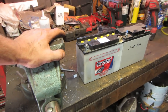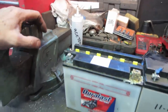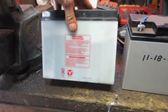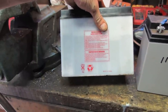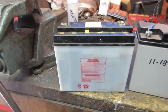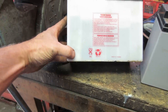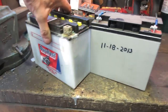Other things I need is a battery. That battery took somewhat of a charge but not a great charge, and that battery has got to be five or six years old. It sat dead, and when they sit dead they don't have a very good recovery rate — they have a tendency to sulfate. The plates get all corroded internally. You can actually see right there where that one's whiter than the rest of them, so you can tell those plates are kind of compromised on the inside.